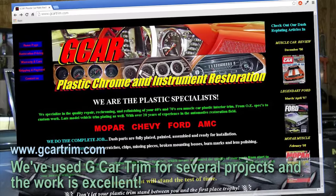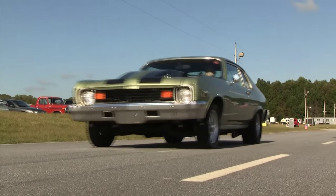Interior detail needs to be a lot bigger too — spend a lot more time on it, maybe recover both the front and back seats, put in new carpet sets, redo all the chrome stuff inside. If plastic pieces need to be replated, buy the parts from guys like National Parts Depot, or if the aftermarket doesn't have what you need, you may need to go somewhere like G-Car plastic plating up in Washington State. The engine, in my opinion, if you're going to wow people at car shows and cruise nights, needs to have a really good, hot, radical cam in it. Even if it's not a big engine, if it sounds really tough, people are going to notice when you come into the cruise night. Chrome, oddly enough, is going to be one of your bigger expenses on a nice cruise night and local car show build.